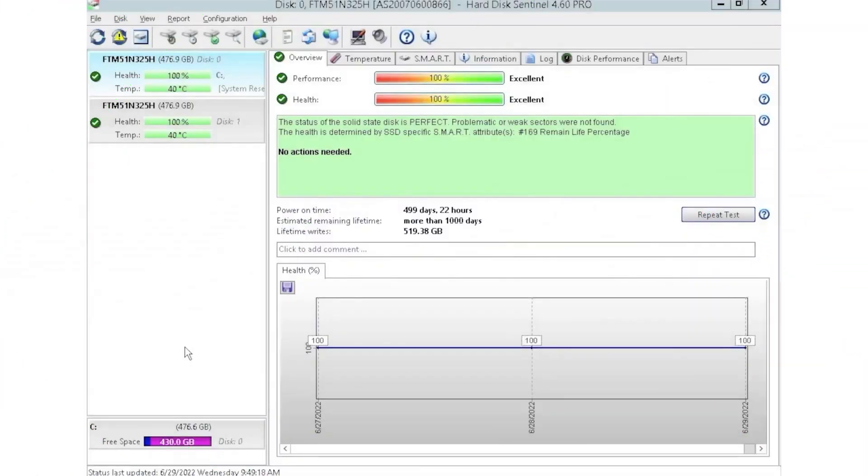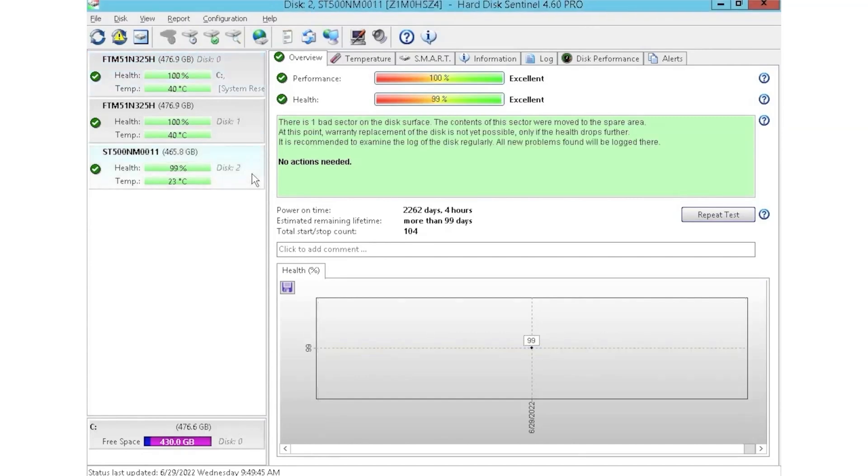I have HD Sentinel pulled up right now. As you can see, we currently have two drives plugged in — this is installed into a storage array where we like to plug in multiple drives at a time so we can test them. HD Sentinel is an awesome tool because you can see things like the power-on hours, which is great especially when you're buying used equipment — you can see how long that drive has been in use. You don't want to be using drives that have been heavily used because you have a higher risk of drive failure. You can just go ahead and plug a drive into the array and it'll automatically populate within the software, giving you health scores. The two we have up top have a 100% health score while the one at the bottom has 99% — so all pretty good.